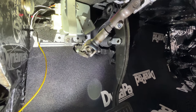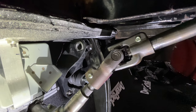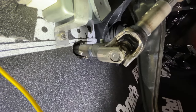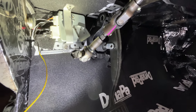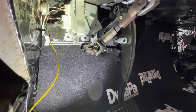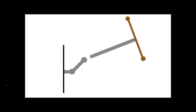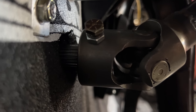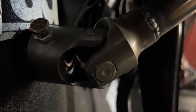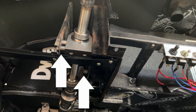This gets worse with higher angles. You can reduce this by offsetting two U-joints like I did in the front, but this only works if both angles are about the same. One here is about 20 degrees and the other is about 50. I didn't bother to clock these two correctly, so they're not doing the cancelling — but it doesn't matter because I'm not going to leave this in. This angle is way too high; you can feel it get really hard to turn and then much easier as the joint goes through its rotation. I can fix this in a few ways. The first is to move the upper pivot further away from the firewall, which reduces both angles — so that's what I did for now. I bought two new U-joints that are much more compact than the Toyota ones. I also inset the splined end into the U-joint and welded it in, so the splines for this connection are actually inside the sleeve of the joint, bringing it closer to the firewall.